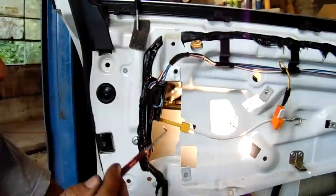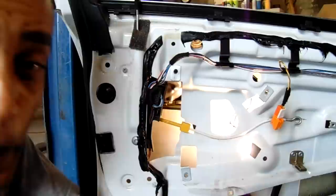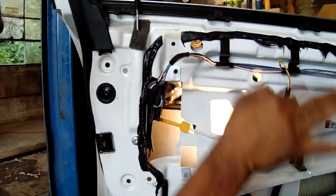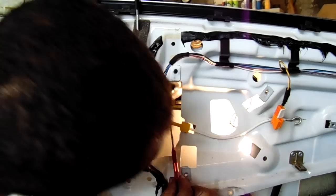We're going to remove the door handle on this BMW 528i series — this is a 1999. In order to remove the handle, they sell some special tools where you can go into the side and pull out a plug and stick it in. But if you don't have those special tools, pull the inner door panel and you'll find the locking piece under this gold plate.